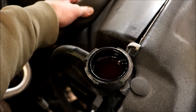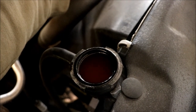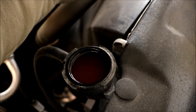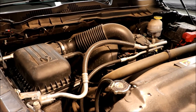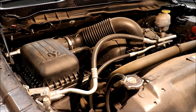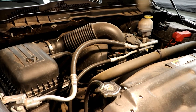This is what I've been doing with the radiator hose — I'll just squeeze it and you see you get some air bubbles. I can feel that this hose has got coolant in it now. That level really hasn't gone down much — it feels pretty full. If you do have issues getting all the air out, another thing you can try is starting the truck, letting it run, and bringing the RPMs up to about 1,500 or so and leaving it there for a few minutes to hopefully purge the air out. I believe that's a procedure Ford uses on one of their trucks. Sometimes it can be tricky — you're just chasing air in the system — but this seems pretty good.